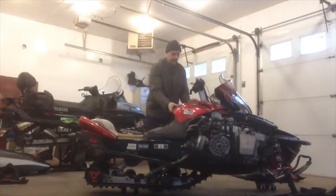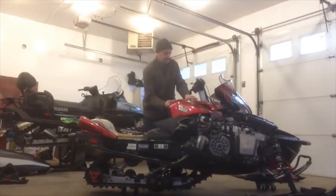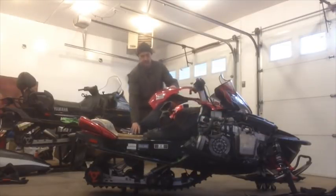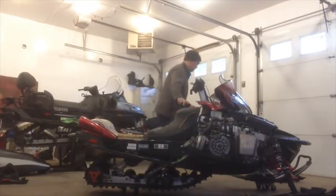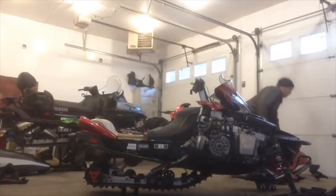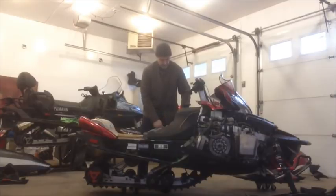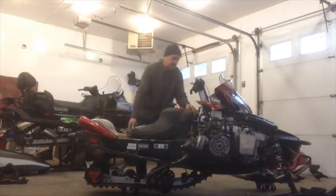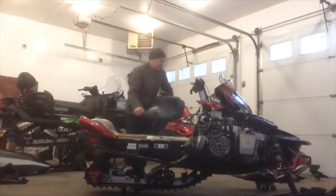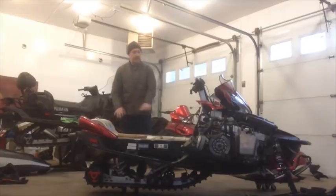Now your gas tank, same thing, you gotta remove your cap usually. Slide it up and out. I kept it all together so it's all one piece. Put your cap back on. You gotta pull your gas tank. You got 2 nuts, 2 wires. Slide your tank out, you'll have a couple lines hooked up at the back. Disconnect them, 1 wire. Move your gas tank. And you get access to your exhaust.